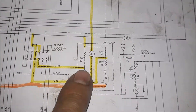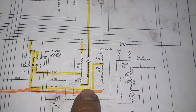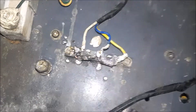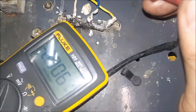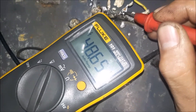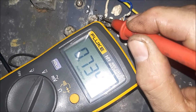There's one wire going to both resistors, and then a blue wire coming off. The yellow wire comes straight from the key switch, and the middle wire is blue. Checking the yellow wire: we get straight battery voltage. Checking the blue wire: we get battery voltage on that too. But on the white wire on the other end, which should read 24 volts, we get zero.